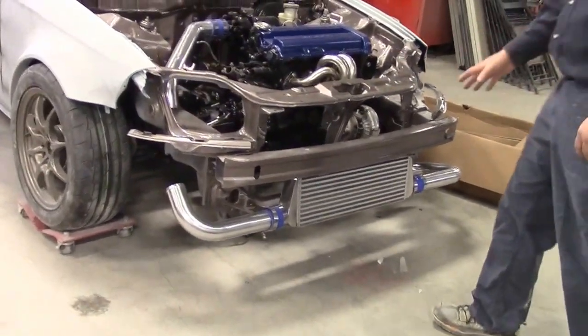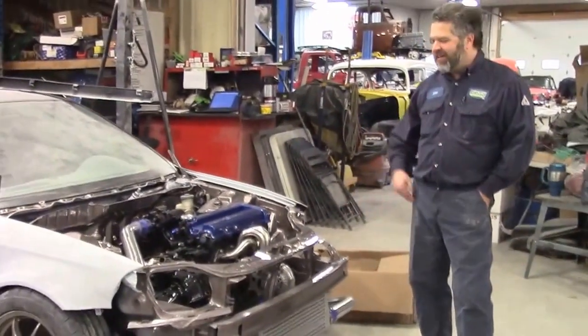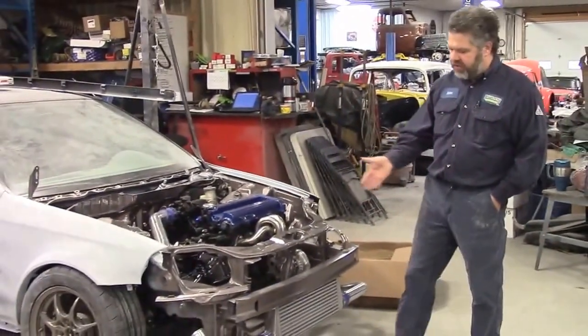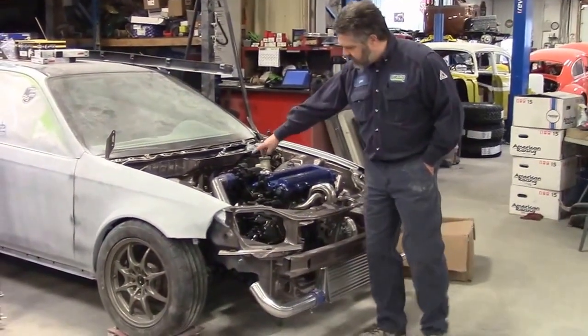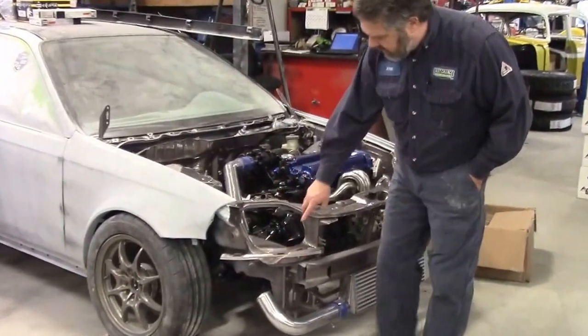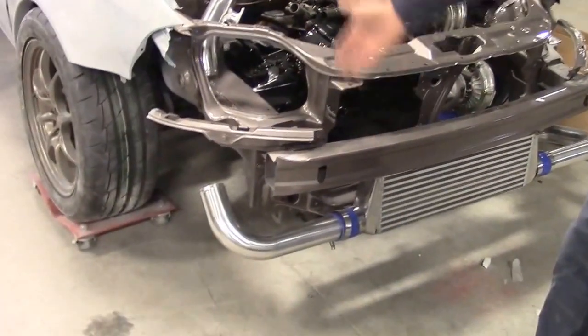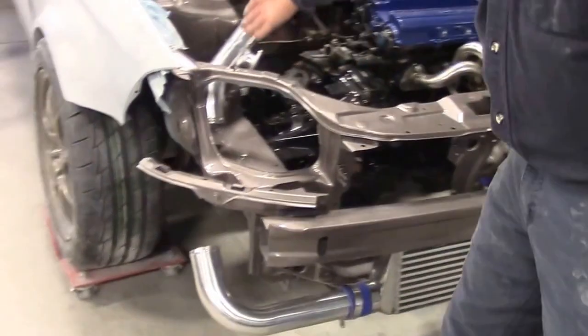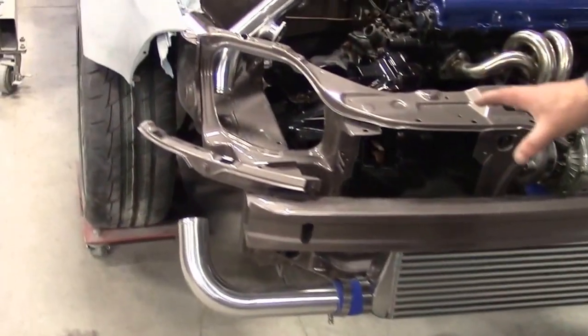This was supposed to be — and they claim it is — a direct fit for this Honda Civic. But unfortunately it's not; there are going to be some modifications needed to fit properly. You can see our tubing coming down this way. These two pipes have to join and you can tell, obviously by the video, they're not close to being lined up. So these are more of a generic kit, it appears.